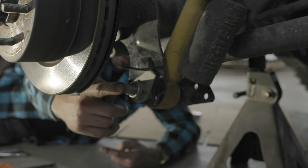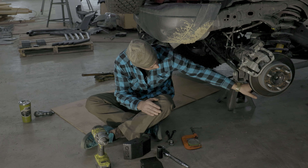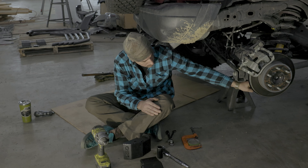These little brackets coming down are so long they're going to start to spread on you, because once this bolt starts loosening up — that's why I have this clamp. We're going to put this clamp up here and cinch it down, so when I loosen things up it doesn't start spreading on me. Before I start loosening my bolts, I want to prevent this from spreading out. You need a clamp that'll open up about four inches or more. We're going to grab this extra meat up here on top and cinch it down until it's nice and tight, but still have room to get the socket onto the bolt.